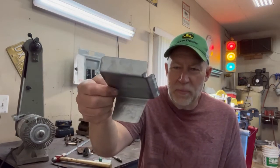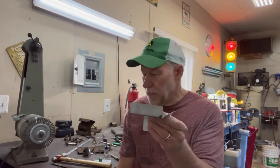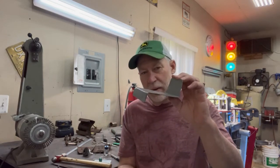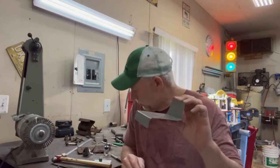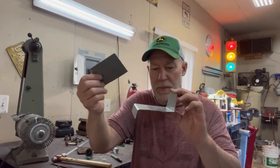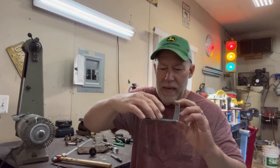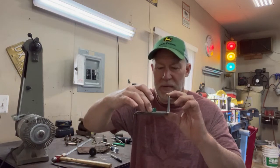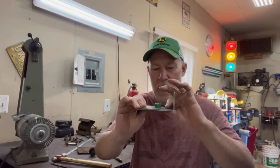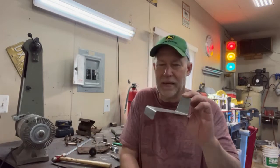I finished up the patch panel and it looks pretty good. I've already had it underneath the car a couple times to fit it — had to clean the corners, put some radii on it, and clean up the edges. It fits really well up there. Next I'm going to put a couple sheet metal screws on a few of the flanges to get it mounted up where I'm going to weld it. Then I'll put the t-bar back on, transfer a hole through the bottom, and rather than welding the nut directly to this piece, I've made a tapping plate to go on top. I'll put a larger hole through the patch panel and an on-size hole in the tapping plate so the nut can float slightly, giving me tolerance in case I'm off a little on the t-bar.